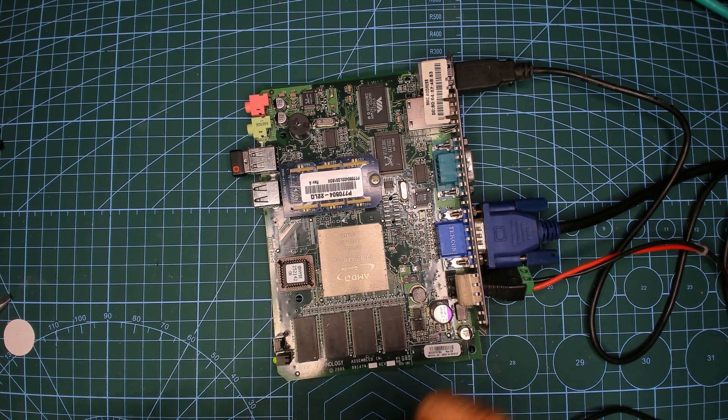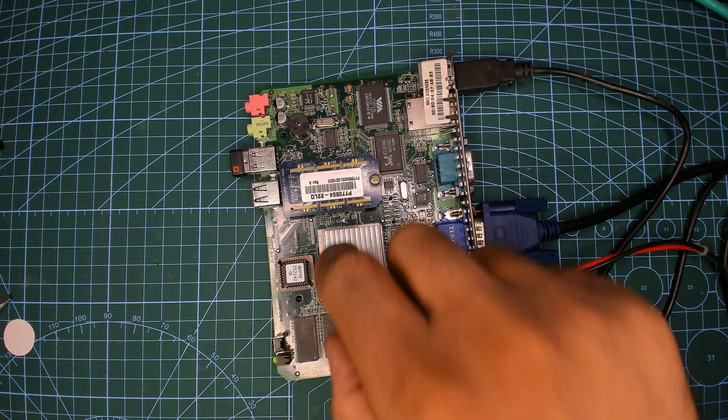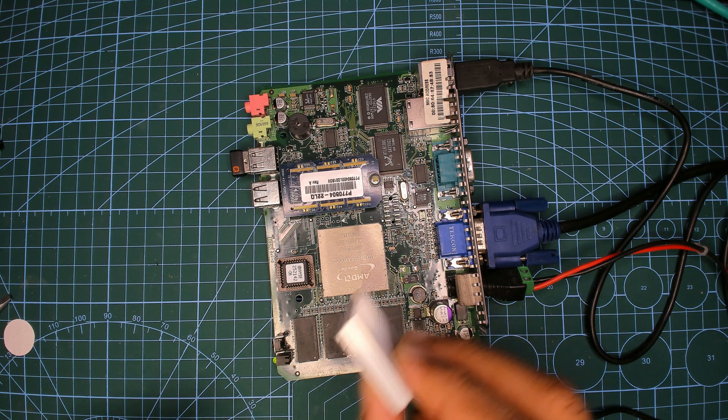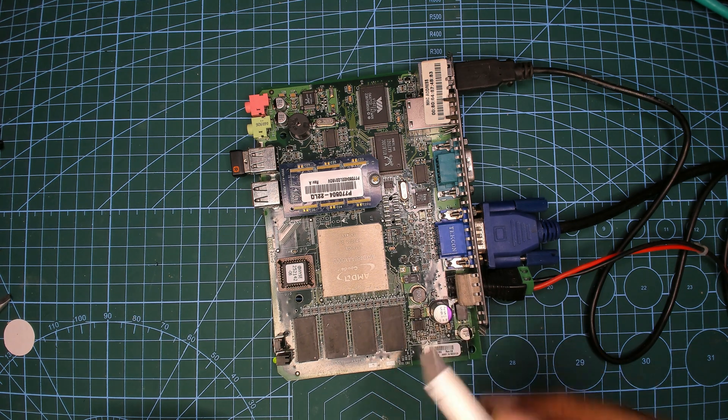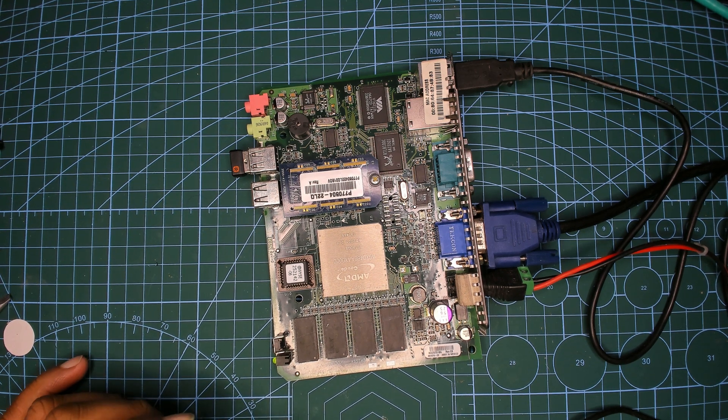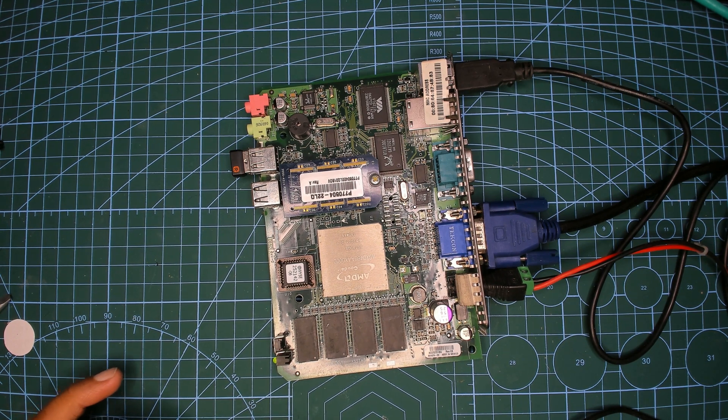It was actually getting much hotter than it would have if the CPU package was just exposed to air. Because it was so difficult to remove, I had to pry it open — that's why you see all these marks around the edges from my screwdriver. It's a very soft, very light aluminum, so even plastic would bend it. It took me around one and a half hours of patiently spraying isopropyl alcohol and slowly prying to get it off. It was very painful but worth it — I could show you guys the CPU inside.